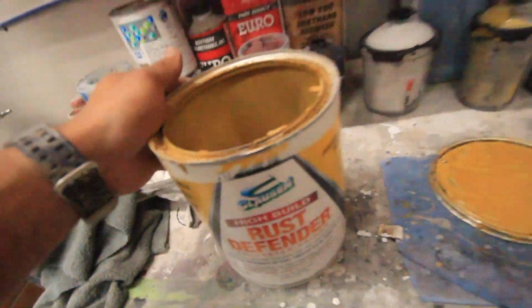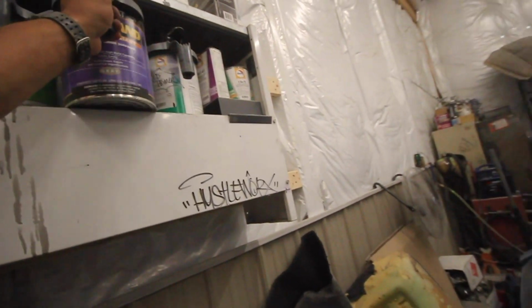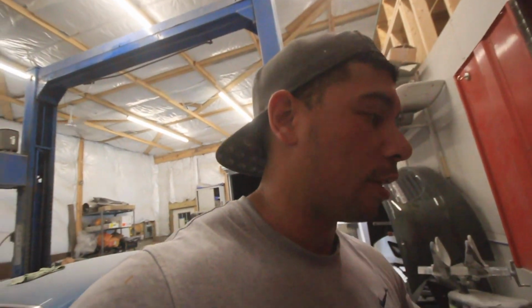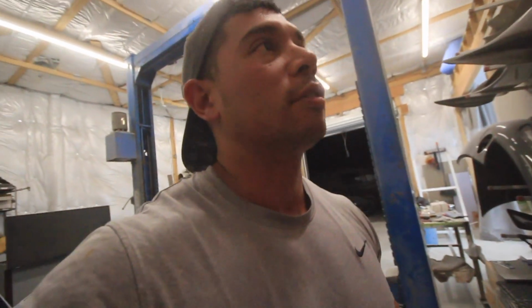I guess we're going to have to use primer. I might have some of this left. That's empty. Okay, we're not gonna polyester prime it. I just don't have time to. I'm gonna have to chance it with urethane. I know what's gonna happen though. As soon as I bake it at work, urethane, it's gonna crack.